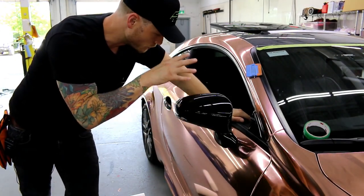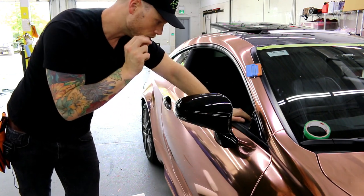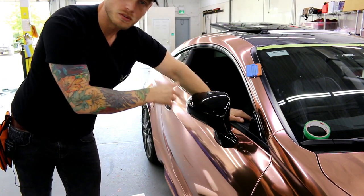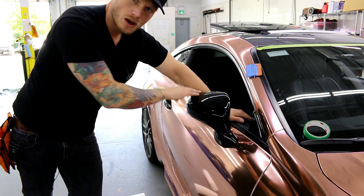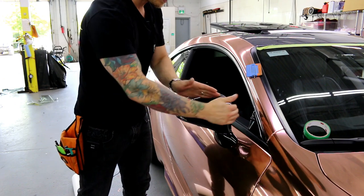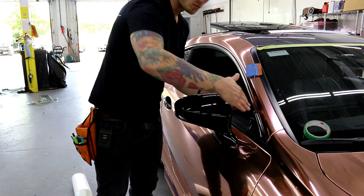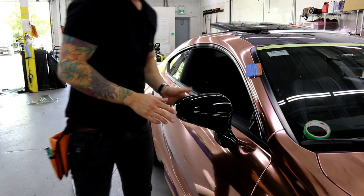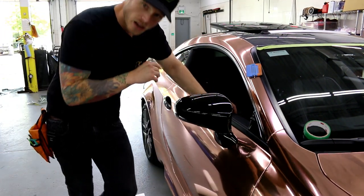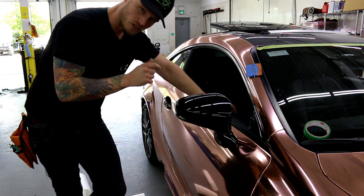Alright guys, if you liked the video, don't forget to give it a thumbs up. I hope you enjoyed the walkthrough of the mirror wrap — two pieces, made super simple, super easy, very efficient, and will last probably forever. This is the way to do it. If you have a bend in your mirror like this with a sharp angle — the mirror actually comes this way and then starts coming back this way — it's just too much for a single piece. If you had more of a gradual swoop out, that would be a different story. But here it's actually reversing directions, so you're going to want to do a mirror just like that. If you want to see more videos, don't forget to hit subscribe. Thank you for watching, take care.